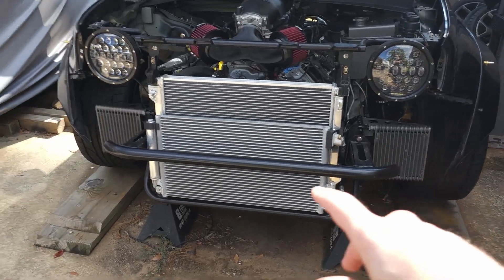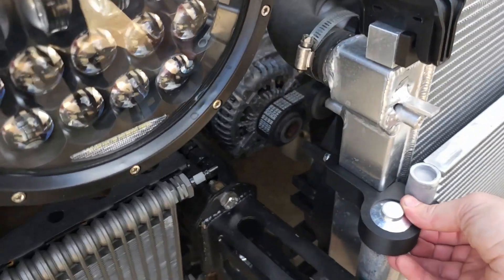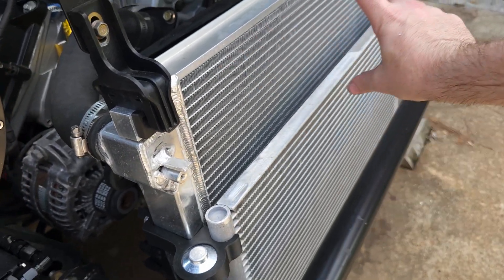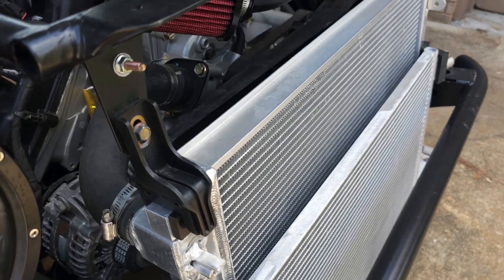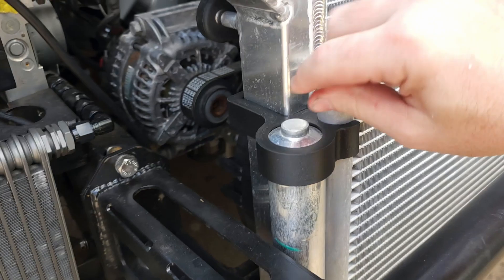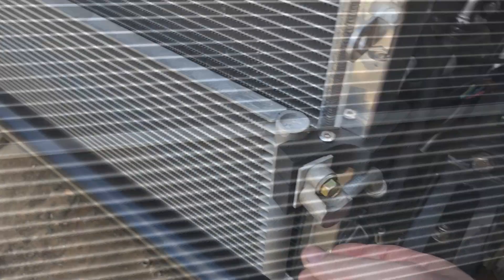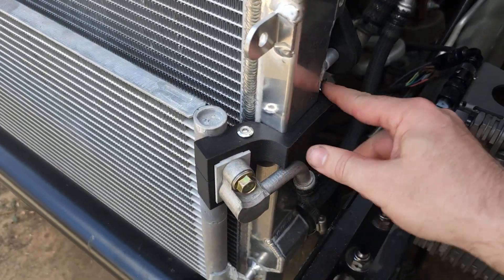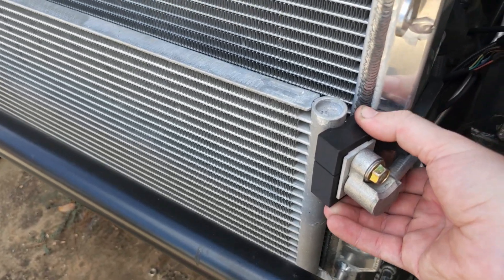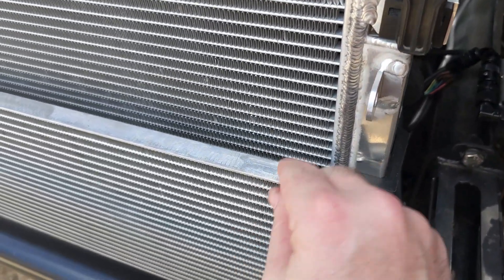So we've got a transmission oil cooler and an engine oil cooler. You can see I made a little bracket to hold the AC condenser because the factory transmission cooler was mounted up here but that ended up hitting the actual front fascia of the Renegade. So I had to make these little brackets here — secures it pretty well, wraps around the radiator, and holds that expansion chamber. And this bracket here is pretty much the same thing — wraps around the radiator, grabs the block, and I made a clamp on there. Works pretty good — it's not going to be seeing a lot of force anyway, but that thing's solid.